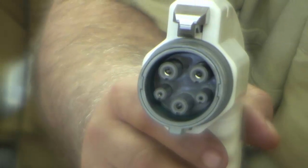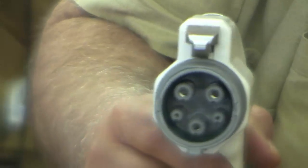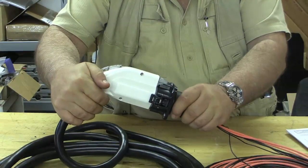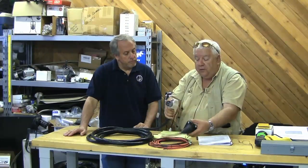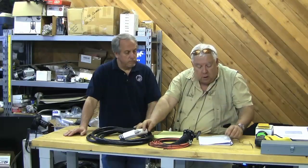The little inlet has the corresponding pins. There's a little latch — you flip that and it opens up. It has a little catch here. The connector slides in, this latch engages, and if you'll notice, it pops a switch — it actually closes switch S3, which is part of the proximity detection on pin four.